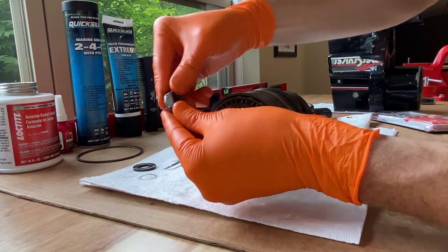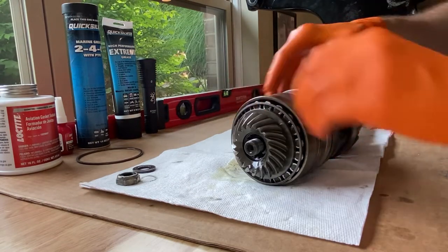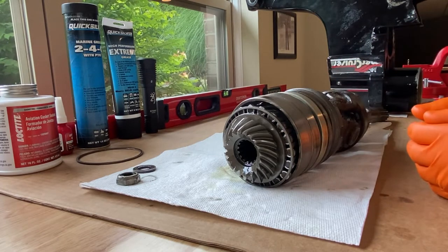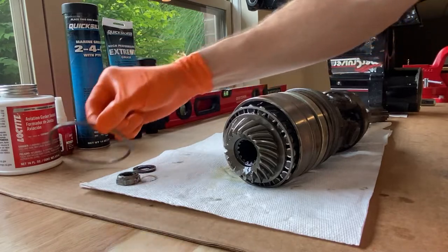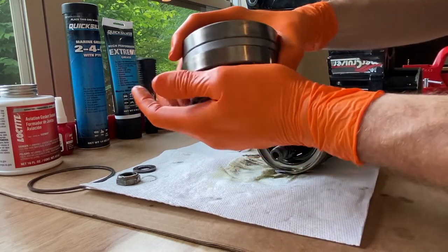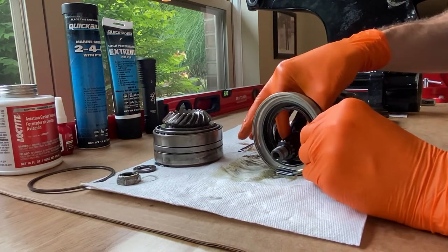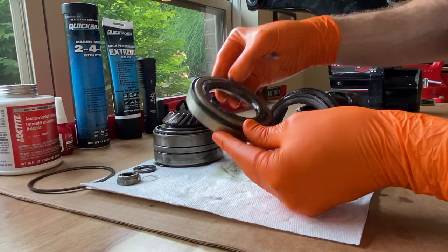Most people replace the nut, but the manual doesn't specify you have to replace it — we are going to replace the nut anyway; it was only about $3 to $4. From here, just carefully pull the assembly apart and it comes out in a bunch of different pieces. I highly recommend taking a few photos before you pull this entire assembly apart. I've got my spacer and shim set over there. I'm going to pull the bearing and gear portion off — this has the inner and outer race as well as the inner spacer. I'll set that upside down and it will leak some oil — that's normal. Next is the oil seal and rubber O-ring, and this little sleeve houses the internal oil seal.